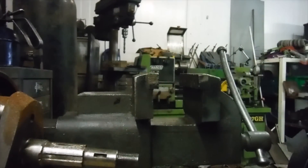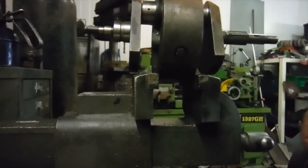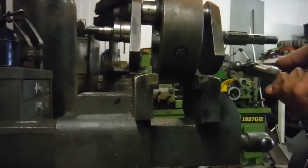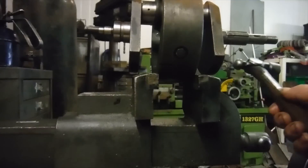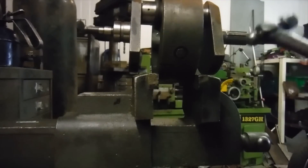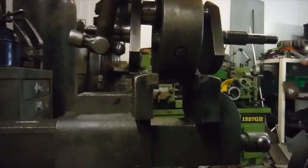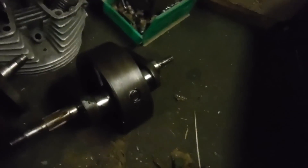I'm not using soft jaws but I'm really not going to damage the flywheels — they're very hard and I'm not clamping too tight. Here's the damaged cracked crank — cracked through the big end journal. Tapping this side makes a duller, lower noise than either of the two on the other crank. And the cracked side — listen to how dull that is. If I'd heard anything like that from the crank we're dealing with I'd be rather alarmed. You can actually see part of the crack — a rusty witness mark. At least we haven't got that dull sound from the crank we're hoping to reuse.